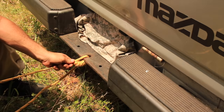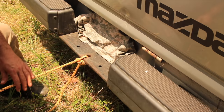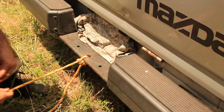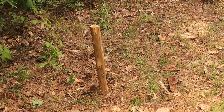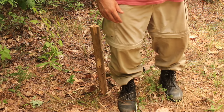It's always a good idea to have some kind of cordage, a heavy towing strap, or something that can be used if you ever get stuck out in the woods or a car in a ditch. This simple machine — the flip-flop winch — will help you get out of a bind. When pulling a real heavy vehicle, I found it's very helpful to put a stake in the ground in line with the drum pole, and a stake on the other side where the drum pole will land.